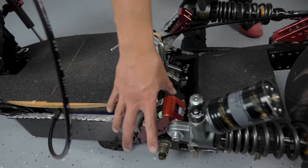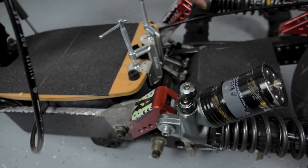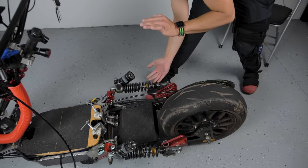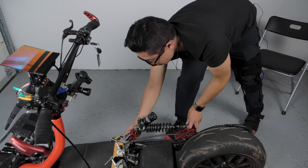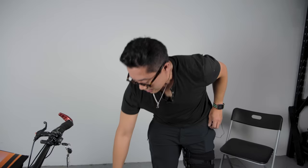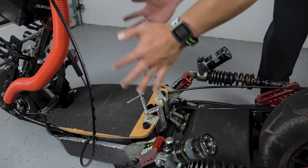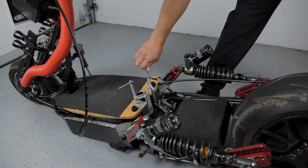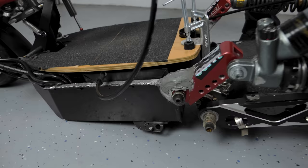This is the original frame here, so I just extended it out. Got some extra motorcycle suspension — this gives me more flexibility of how to mount it. Normally on a motorcycle, the shock is supposed to be up here, and you can tilt it back and forth to get a feel of suspension. Originally there wasn't enough of a triangle to keep it from twisting, so raising it up helped it get a lot more stable. These C-clamps definitely help because the frame twists right here and actually shifts sideways. I got some wooden boards just to keep it from twisting — now it's really solid. When you turn and lean, it moves everything together.